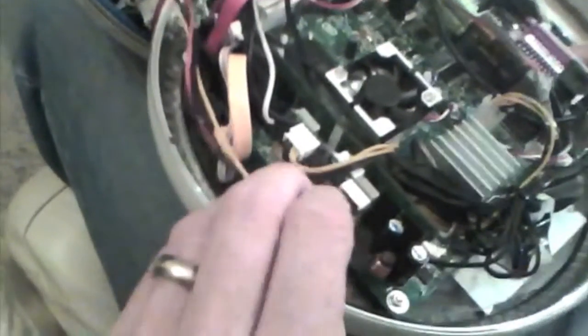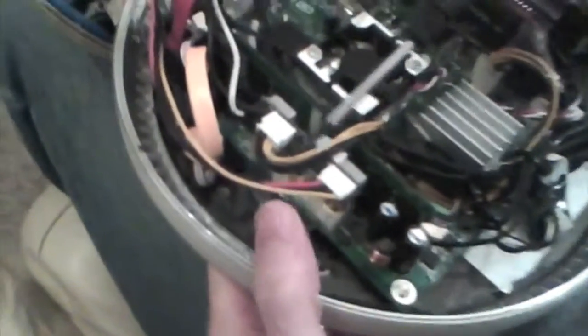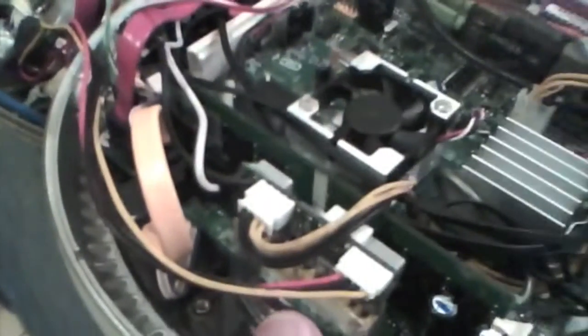Now we plug in — this is the power for the SATA hard drive, it just goes into this one. You can see this is the Pico 24-pin ATX header. It takes 12 volts coming in from the power supply from the original Mac and converts that into what the motherboard needs — it's got the Intel power header there. And I'm using one more USB port for the Bluetooth, which is in the flap here.